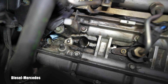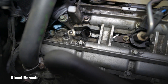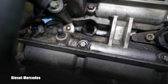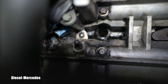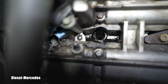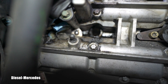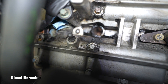This endless cleaning and getting rid of this horrible stickiness is important. You can see you cannot even see the hole for the hold-down bolt - it's filled with that goo. That will take a lot of time to perfectly clean because it needs to be correctly torqued - there is a whole procedure for it. Therefore it must be absolutely perfectly clean. A lot of challenges here, definitely a lot of work still.